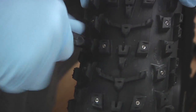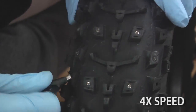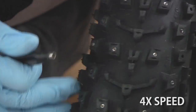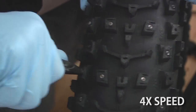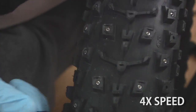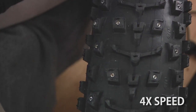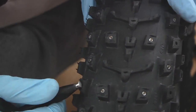I'm doing this on a mounted tire — basically it's on a wheel, it's inflated, probably to about 8 or 9 PSI. I have the wheel off the bike and in front of me. I'm sitting down with the wheel between my legs, which allows me to support the wheel as I'm putting all the pressure on it to get the stud in, and it also allows me to quickly rotate the tire once I've got one in. You can get a pretty good rhythm going once you get going with it.